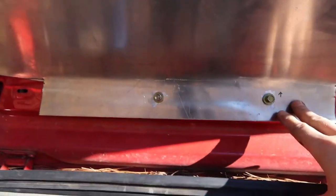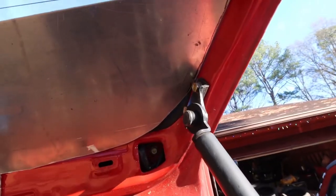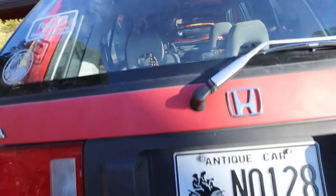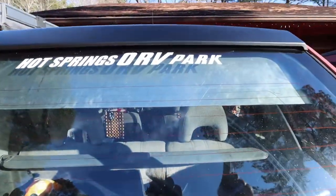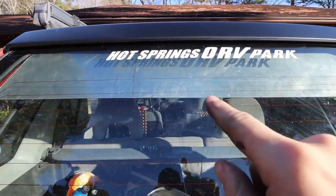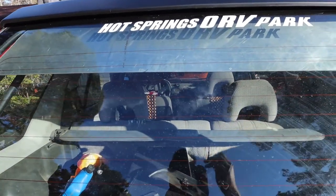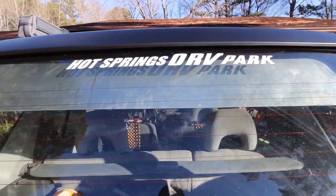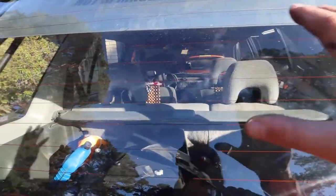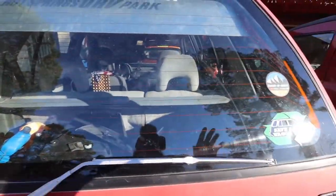So a little bit of an update — I do have these two bolted in and it's looking pretty good. I just need to do a little bit of clearance in here as you can see from the marks I made. When I close this, I need to bring that side up just a hair, so I need to slot this bolt hole just a little bit to make it more level. It's really hard to get a level in there on camera, but I think it'll be on the money. I checked the view from the driver's seat, and it does decrease my visibility a bit, but I can still see behind me just fine as far as traffic goes — that's a good sign.